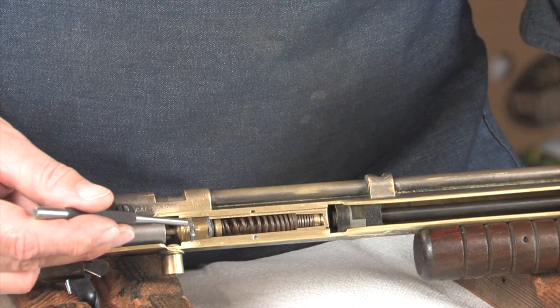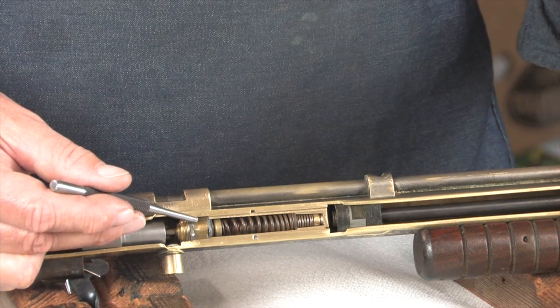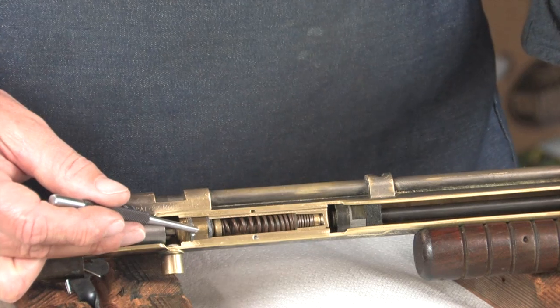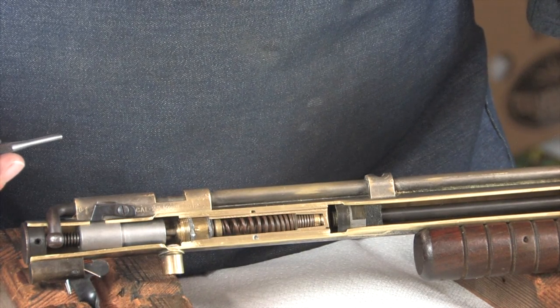And this particular valve body is a single port. Some are two port, some are single port. And so the alignment, there's a little tab right here that would have gone into the cutout part, and you have to align that tab when you insert the valve body back in.